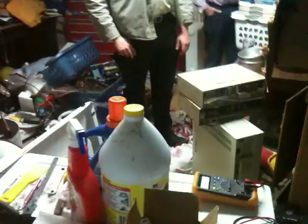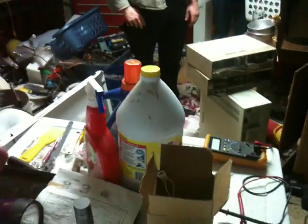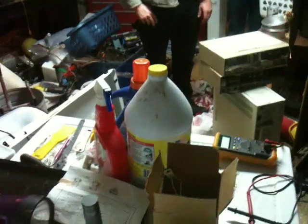And then there are a series of thermal protection devices and thermostats on this thing. These right here, at least one of these is the thermostat. And then this down here, which you can't hardly see, is the thermal protector. And lo and behold, the simplest things bring a complex machine to its knees. That's something to think about when you're trying to troubleshoot something. The things that have the most impact on a device's operation are usually the simplest root causes. In this case, after so many years, that little thermal protector finally opened up.